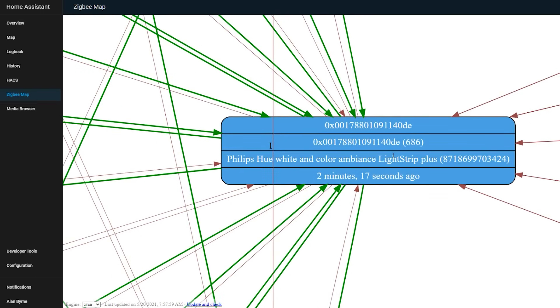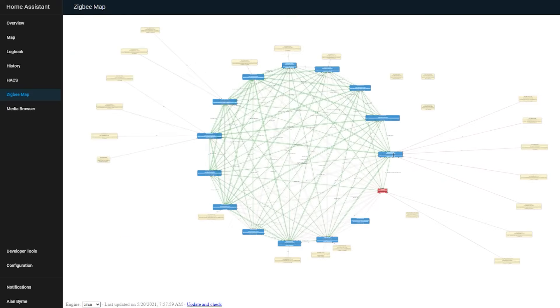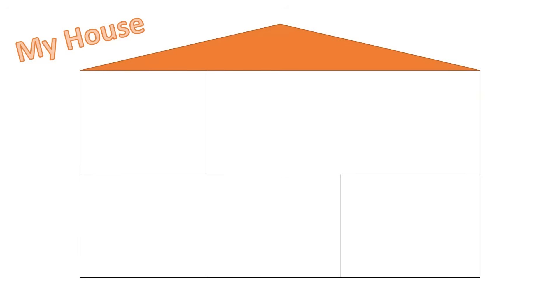I explained this in more detail in my 'What is Zigbee' video, which I've linked in the description. I wanted to make sure that my routers were correctly placed and paired so that my Zigbee mesh network is as robust as possible. This required a bit of pre-planning about where I could place my smart light bulbs and my battery-powered sensors, and I had to make sure I paired them in the right order. Radio signals generally emit outwards in a sphere, so you'll get better results if you place your Home Assistant server with your USB coordinator attached somewhere in the middle of your house. If you put it in the basement it will probably not reach the top floor unless you have routers in between, but if you can put it in the middle somewhere it'll probably work better.